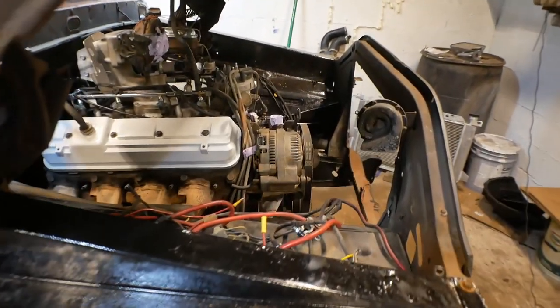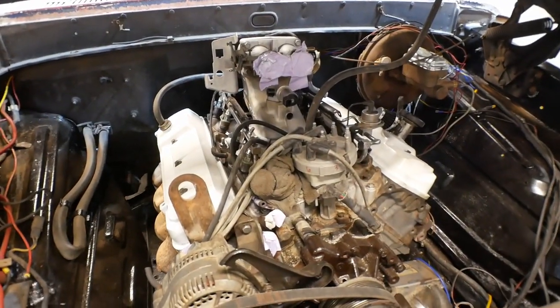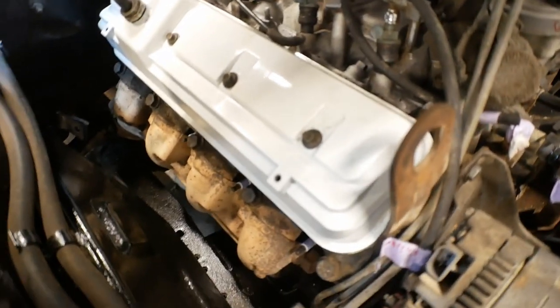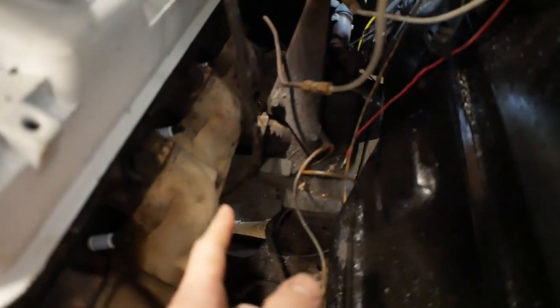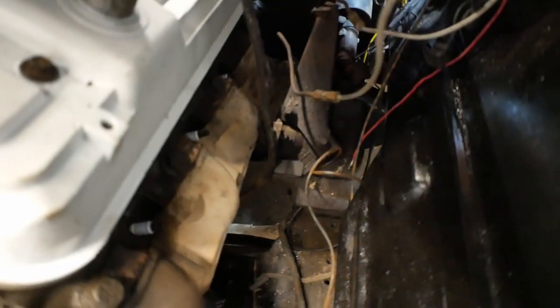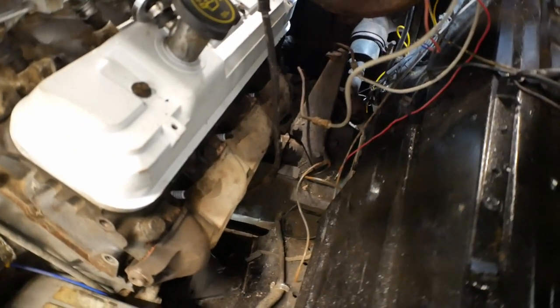There are other things that haven't been shown in video just yet, such as the fact that the exhaust manifolds are both on, including this side where you can see more what I was talking about with the spacing. Plenty of space between the actual manifold and the steering box. It was simply the stud for the dipstick mount that was a little too close.